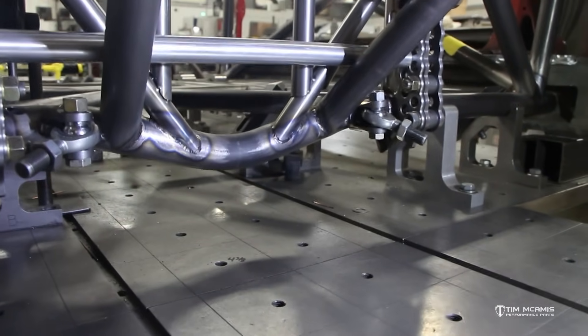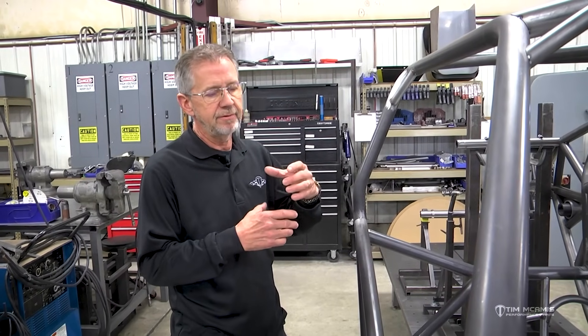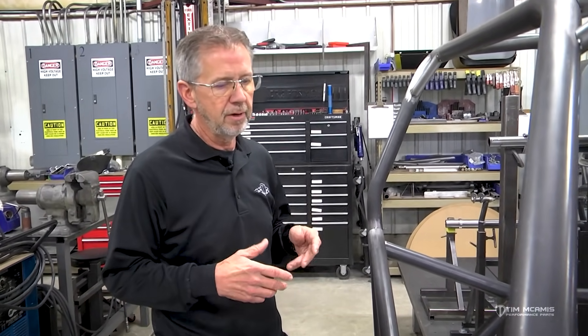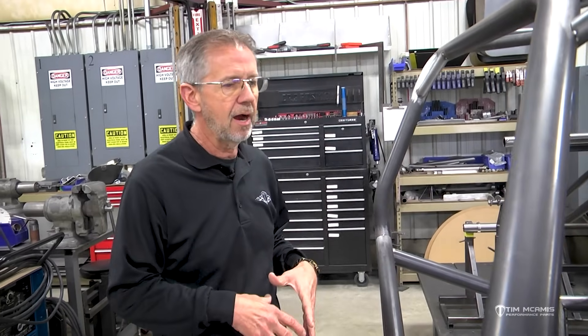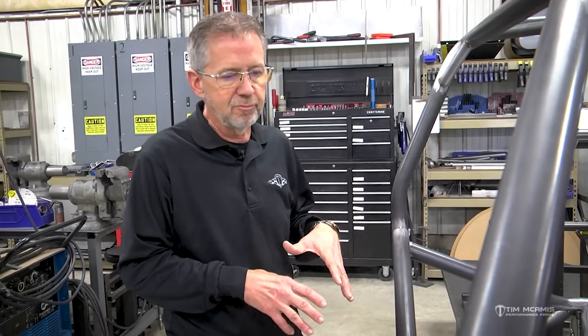Some of the development in that has been a lot of extension on the rear shock — really driving the chassis and the shock apart, especially on no prep stuff, to try to push that tire into the racetrack and use that extension to your advantage to get as much traction as you can out of a small tire on an unprepped racetrack.